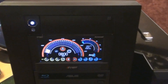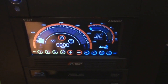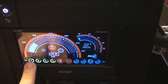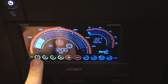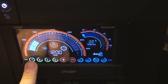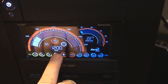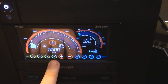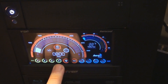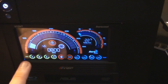Let's go ahead and start at the top. He chose the Aerocool fan controller, which is a very good fan controller except for the viewing angle — that's the only thing I find I don't like about it. I've set up all the exhaust fans under number one, which you can control the speed of. I tie my exhaust fans together because why would you want to change the speeds of individual fans? It just doesn't make any sense. Number four is the speed of all my intake fans, which most are the bigger 120 or 140mm fans, so the RPMs on them are a little bit less.